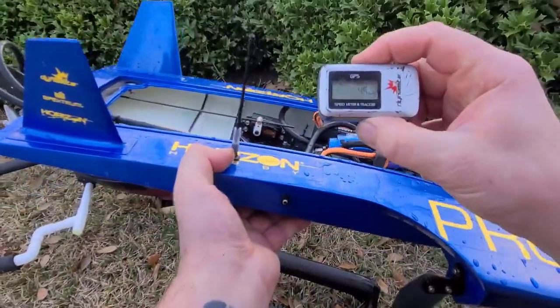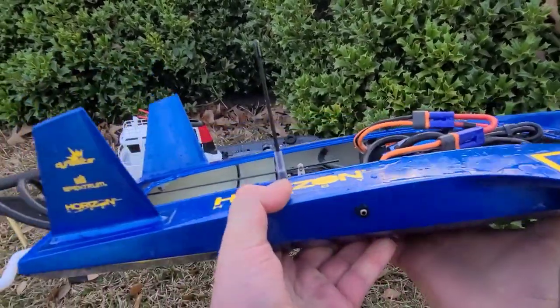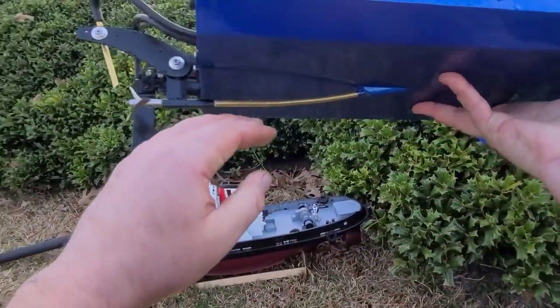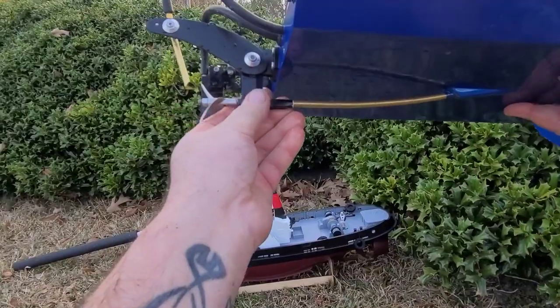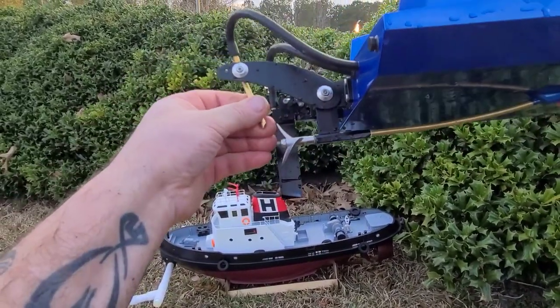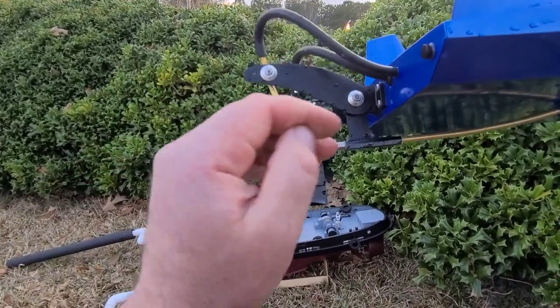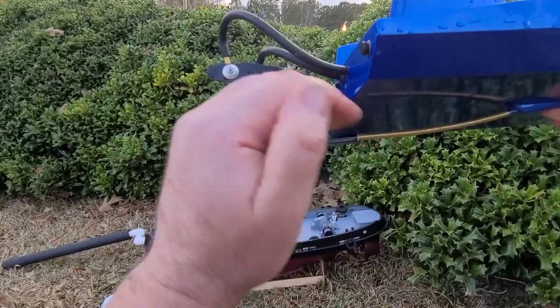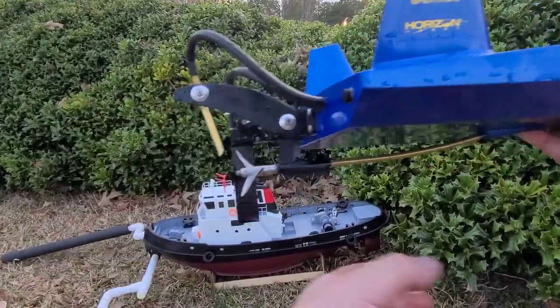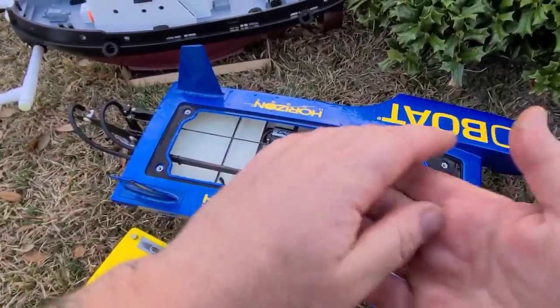All right, we need to pick up on the speed, okay? I know it'll do better than 45 miles per hour. I know it will. We'll start fine-tuning the strut, getting it in the prime position. See if we're creating too much drag back here with the blast pickup. It might need to go up some or in some, maybe even shorten this up, get some weight off of there. Start fine-tuning the boat, trying to get some speed.